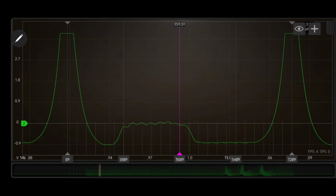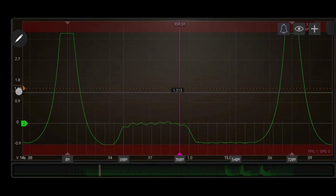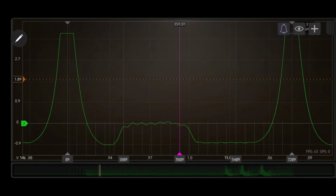I do apologize. But so our towers here, what we want to do is, if you had the actual full tower, you would want to come down halfway with your ruler, halfway down your towers, right? And you would want to measure the distance between where this ruler intersects here and the top dead center mark, and where the ruler intersects here and the top dead center mark, and make sure they're darn close, because you don't want the towers to lean. Leaning towers during cranking or idle means a sign of a mechanical error. They can lean during a snap and a decel, but they cannot lean during cranking or idling. So that's how we do that.